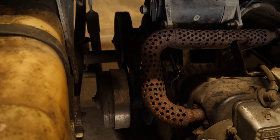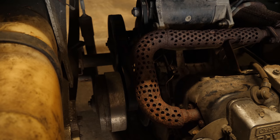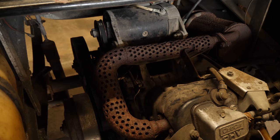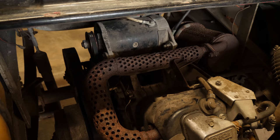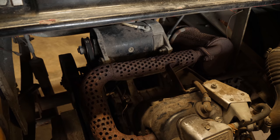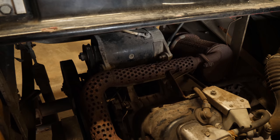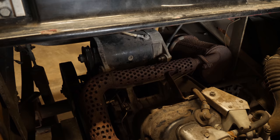So there's a problem with that. I've already done a battery test on it — the battery's okay. I've charged the battery up for 24 hours on a trickle charge, so I know the battery's good. I tightened the belt up on the starter generator twice. So we're going to replace the starter generator. The brushes are worn down but still have probably 50% of their life remaining. There are issues internally — it's just weak. So we're going to change it out and put a new one in.